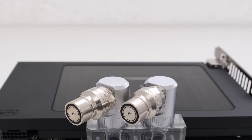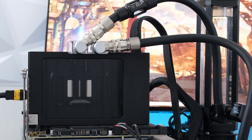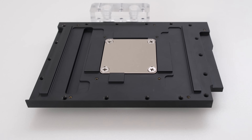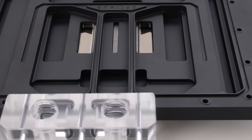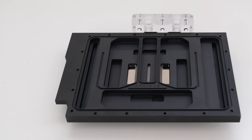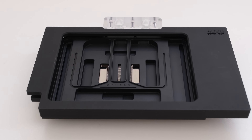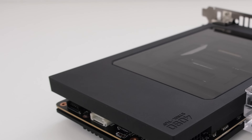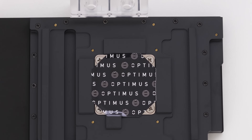The Optimus Signature block is better at cooling, but can it rival the Asus Matrix Platinum as the ultimate 4090? This Strix was able to sustain an overclock of 260 megahertz to the core, an increase of 60 megahertz over the air cooler, rivaling the additional 60 megahertz factory boost clock of the Matrix 4090 over the Strix 4090. The memory was overclocked by 1400 megahertz, an additional 500 megahertz over the air cooler. During the stress test, the card averaged a boost clock of nearly 3000 megahertz — 2975 megahertz — resulting in 107 FPS in Speedway, a 7% increase over stock. Testing of the Matrix by TechPowerUp and Guru3D found a max boost of between 3000–3100 megahertz, approximately a 1–4% clock speed advantage, achieved perhaps by the binning of the Matrix.